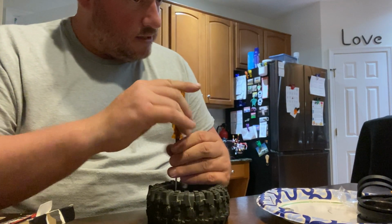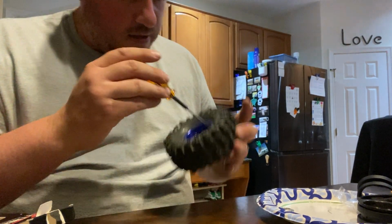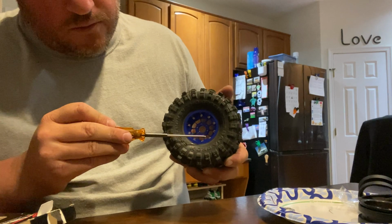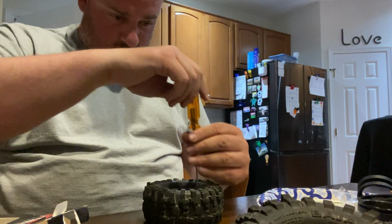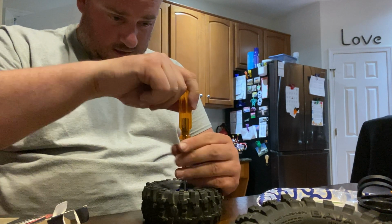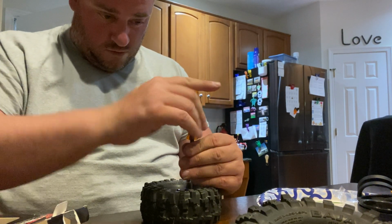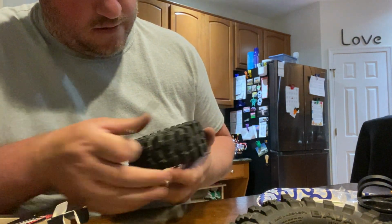Hey, I'm going on 10 minutes a tire. That's not very bad. I'll tell you what, the factories were a pain in the butt. So now as you go around, you'll find certain ones loose as you're starting to tighten the rim down. You don't want to over-tighten it. Just keep jumping from one side to the next. Keep tightening it down to a point where it won't go anymore, and make sure to check your line around there.